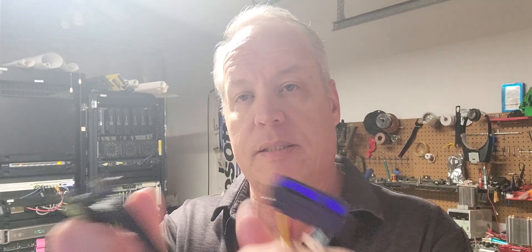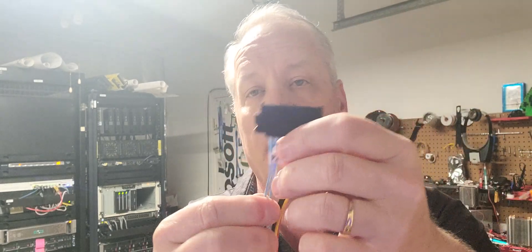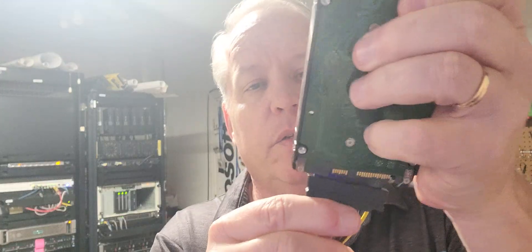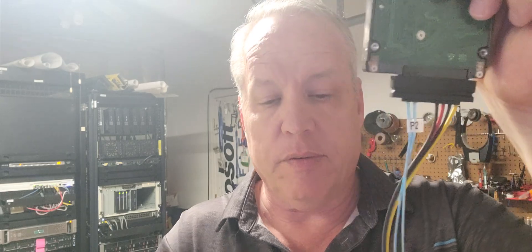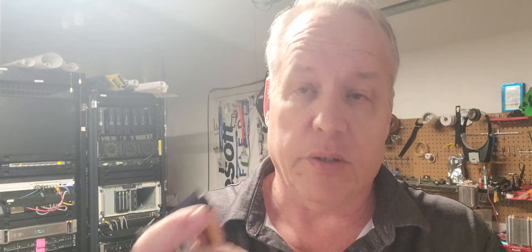The last thing I'll talk to in this video is this guy. Again, I told you and I will tell you again — yes, this will connect into a SAS drive. This is a Molex connector here and the SAS bridge cable here, and then you've got your SAS disk here. You mount that right on there like that, and you can do four of them because this cable comes with four. It is the most succinct way of providing everything you need to, unless you've got a disk array that does it for you — you're going to need something like this. But guess what's on the other end? That SAS head.